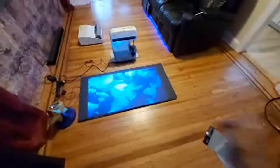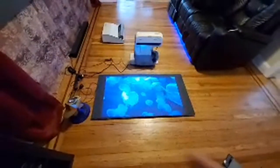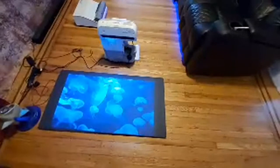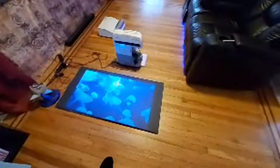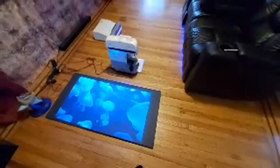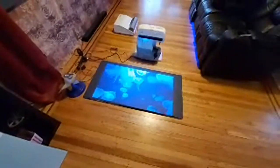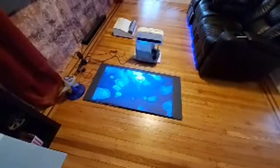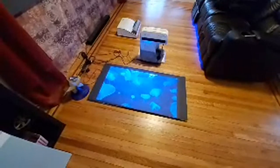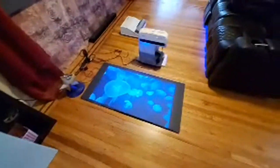To bring the image all the way down, to make it look very dark, and say, look, I can't even see the image. The minute we see that menu pop up, I can tell you how to adjust your projector from my end to get your image to pop up. All you've got to do is push that contrast level up a little bit more, and the brightness. The brightness doesn't even have to be past 20. I did one for a fellow who called in, and I had his settings at 50 for the brightness and around 40 for contrast. Came up perfect, no problem.